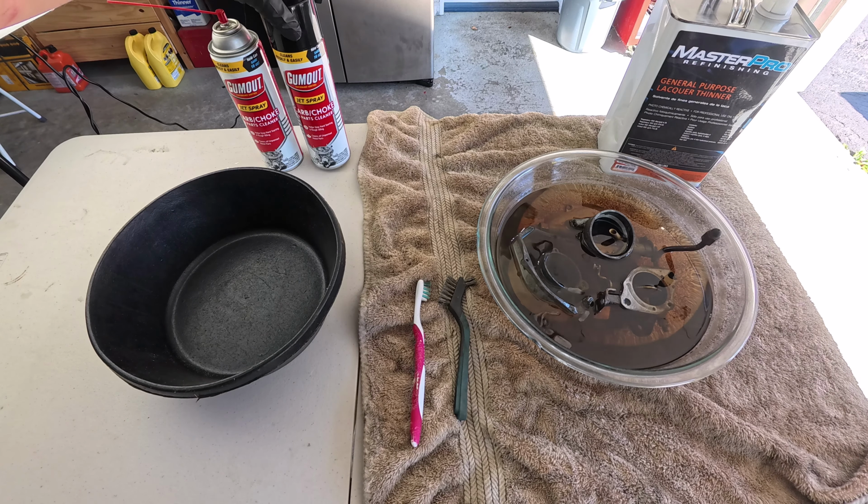Okay. All right. What is the next step? Okay, step 2. We're going to invert the float bowl and put the throttle body back in. Does it go there? Nope. It goes like that. But don't forget the gasket. I'm just aligning it, making sure that I know how this goes before I put the gasket on. I'm all backwards. It doesn't go that way. It goes like this.